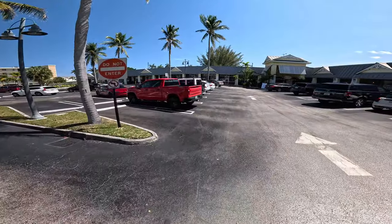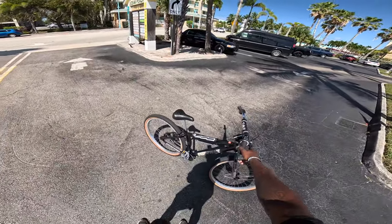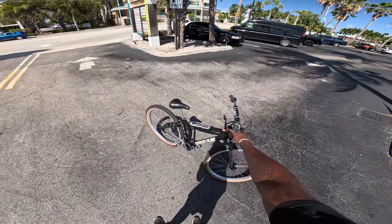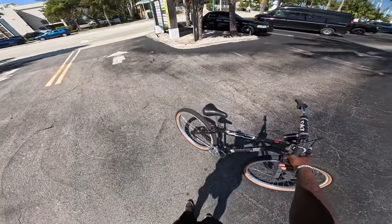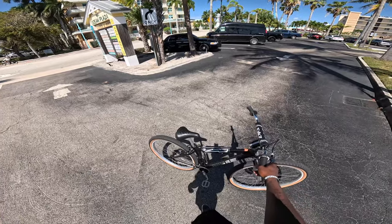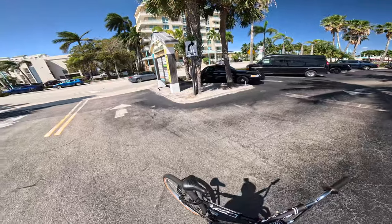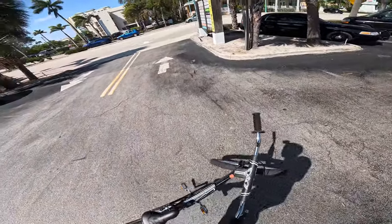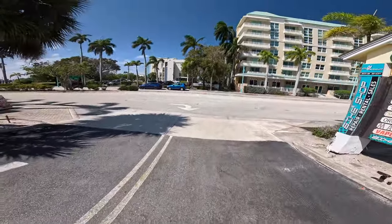Let's go ahead and show you guys the bike. Got the new stickers installed — you can see that reflective though! I'm curious to see how a 36-15 gear ratio is going to ride; I've never run that gear ratio. It could feel different. I might not notice a difference, but I think I will because whenever I put a 15-tooth freewheel on a bike, it just feels different. Alright — first wheelie with the new gear ratio.